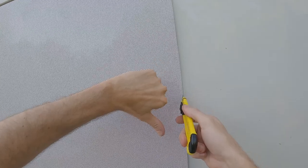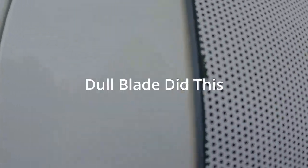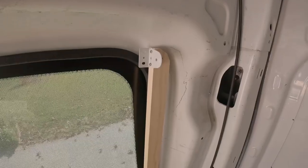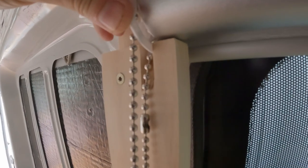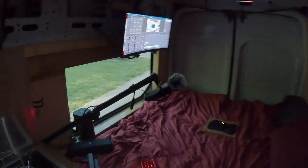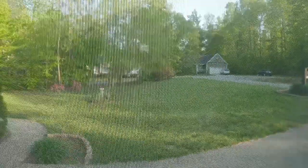You have to get the cut as close to the window as you can, or else it will peel off in high winds, rain, or weather. For the window curtain, first I framed out the base of the window sill below, then I screwed in the two side bars of wood the curtain mounts on. The curtain is secure but not held close to the window, so I added thicker wood over the top of these bars to cover the sides of the curtain so light does not shine through. I used wood stain and three coats of polyurethane.